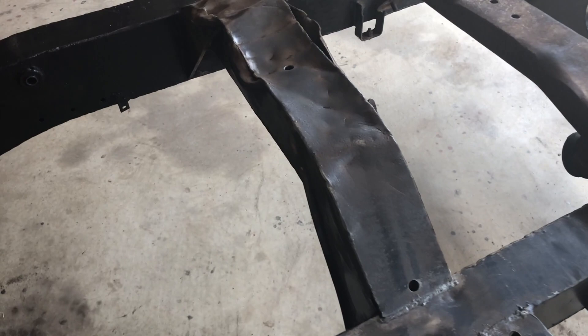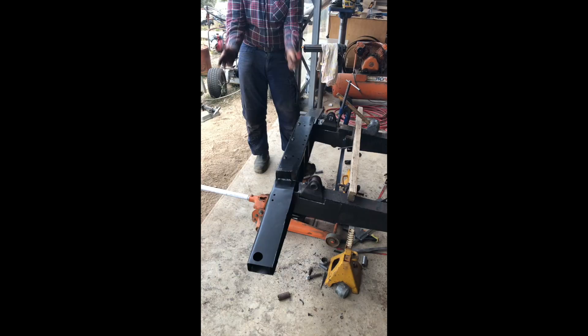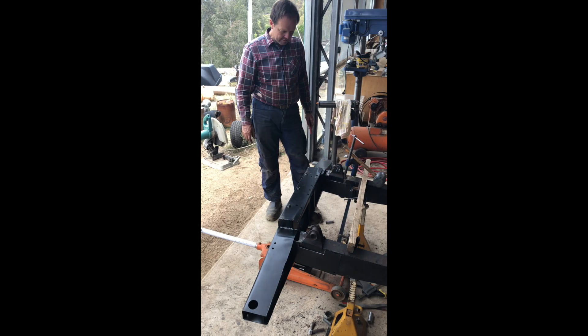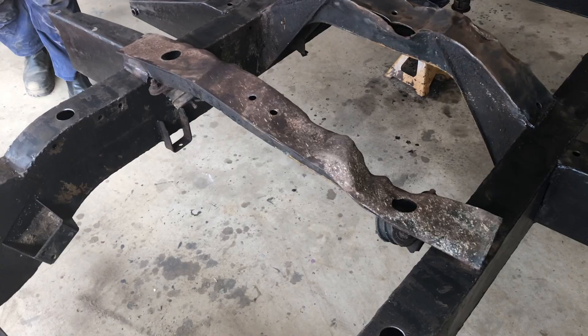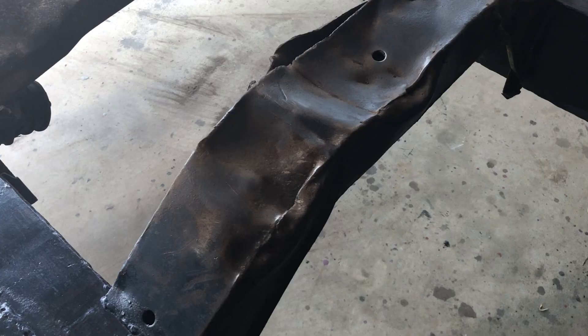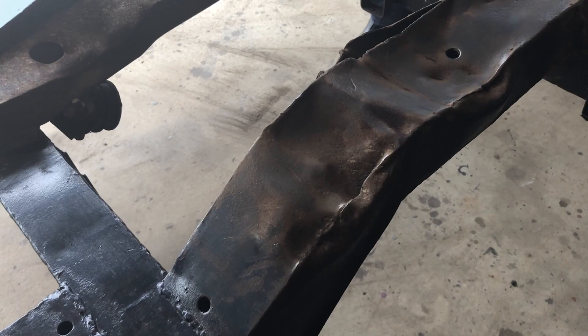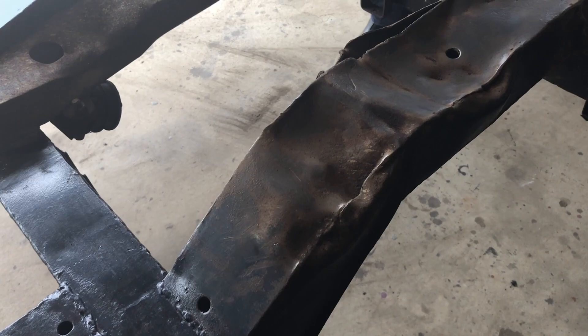We discovered a few more ripples and wrinkles. So as English Steve-O suggested, next week we'll probably fit the tub, mark it all up and weld the rear crossmember into position. We'll also be cutting this off and replacing it with the one we've received from England. And I guess we'll also be making a decision about what to do with this crossmember — but I suspect we'll be repairing it. As John said, it's all flat plate so it's pretty straightforward to repair: cut that out, ding it out, do our thing with it and that should come up okay.